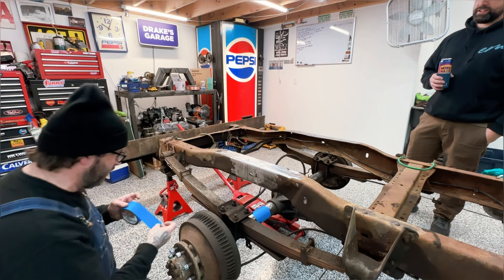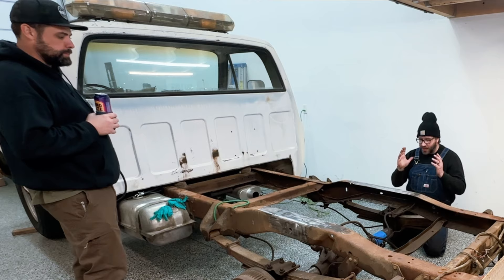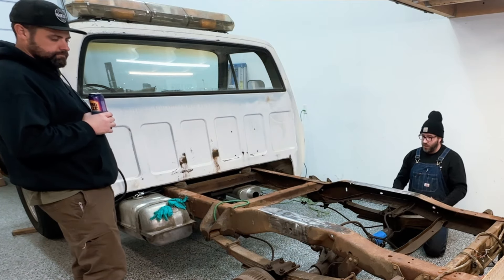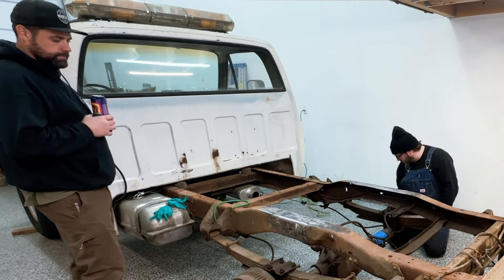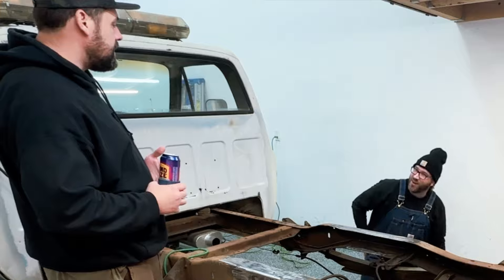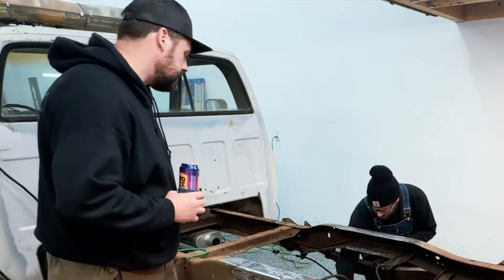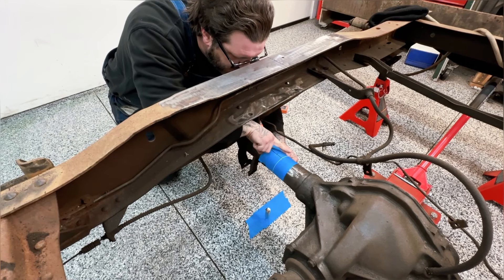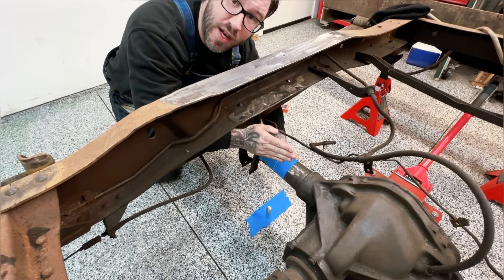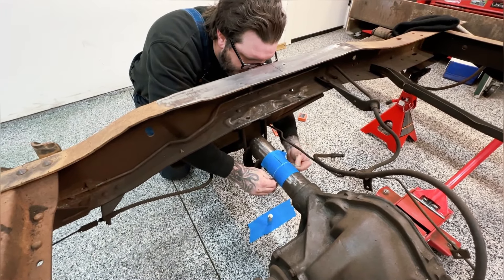Now let's reference the frame. Then this side is done. This is crucial. I don't care if this takes a day — I don't care if it takes two hours a week. This is the most important step. So now what we're doing is we're doing a reference off the axle to the ground on this side and then on this side — that'll also let us know that the axle is in line forward and aft.